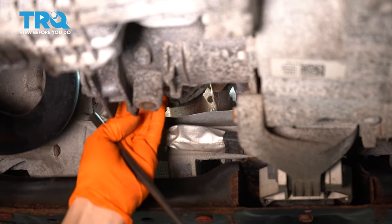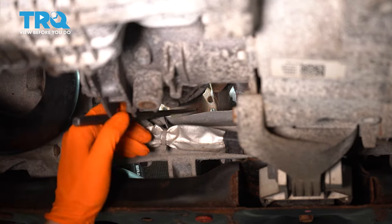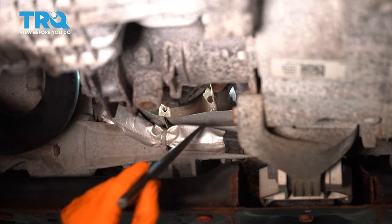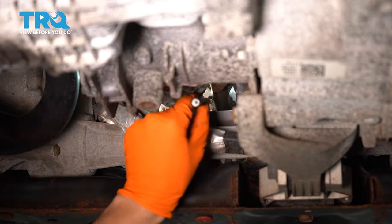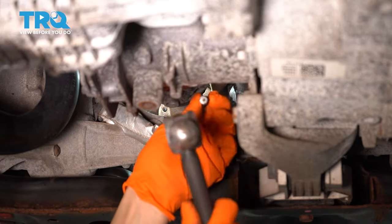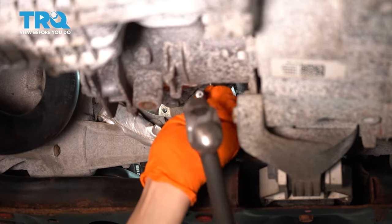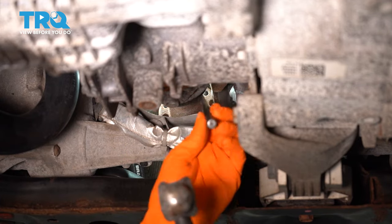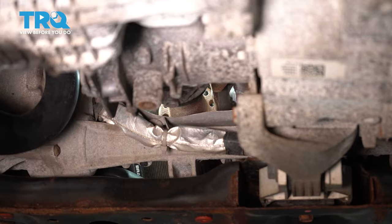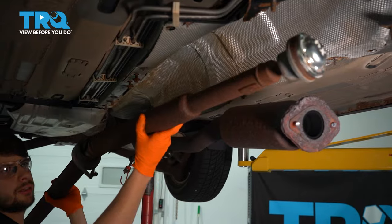Okay, pull this down. In the back of the drive shaft, that would be from the transfer case side, you'll see all the threaded holes where the bolts came out of, but then you will see two non-threaded holes, which you'll notice immediately because they're rusty. You have to stick a punch in there, a long, narrow punch, and with a hammer, tap the drive shaft out. Hopefully this works out for you. I'm gonna grab the drive shaft, slide it out, and set it aside.